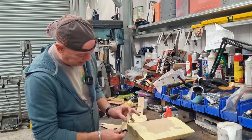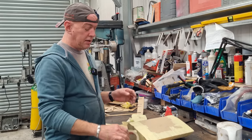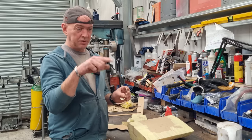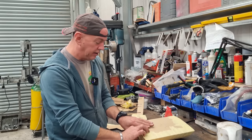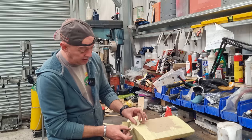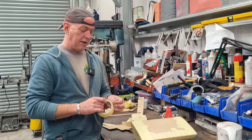The bike is still running, still makes good power, still got good compression. I've had its lid off, I've checked my valve gaps, I've done the cam chain tensioner, I fitted a manual tensioner because the starter motor alternator chain was clobbering the clutch plate, all that sort of stuff. And it fires on the button and it's just brilliant. Makes really good power, it's easy to ride, it's not a problem, it's got that noise. It's got a horrible noise to it and I don't like it.